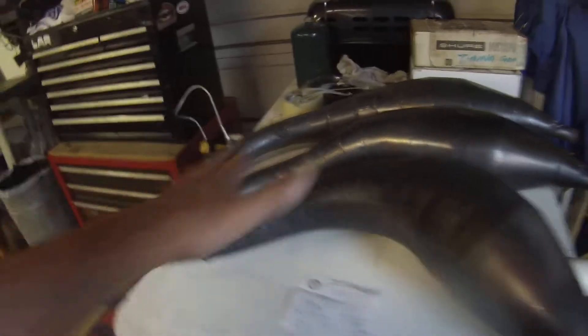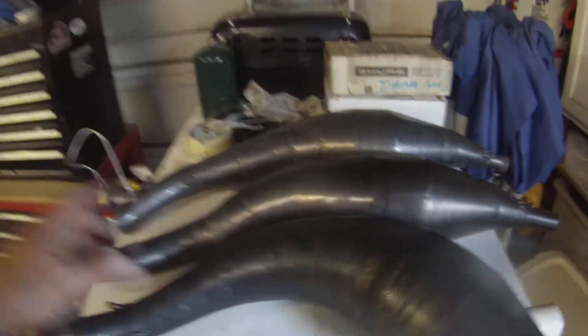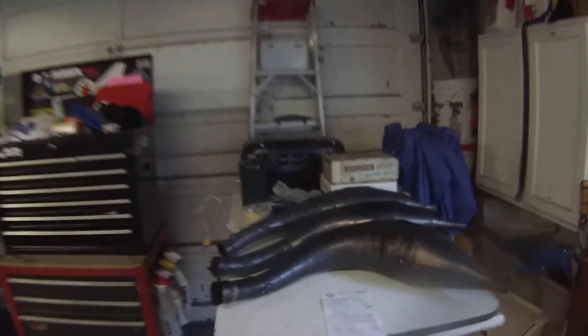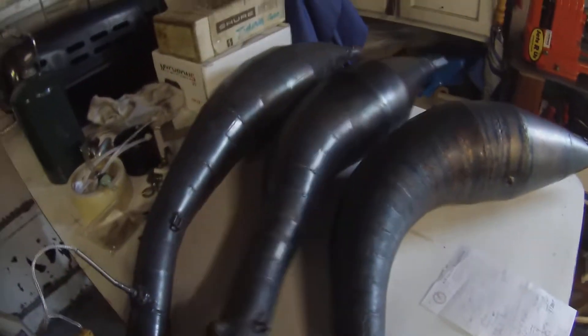You can see this bend in the RVXX pipe looks a little funky, but it had to be done that way because the flange comes out on a downward angle. The exhaust goes down on the RVXX — you can see it's either flat or actually uphill a little bit — and that has a lot to do with how the pipe sits on the cart. Although it looks funky, it doesn't matter what it looks like as long as there are no sharp changes. That's a nice fluent flowing setup, and we didn't hurt that pipe at all.